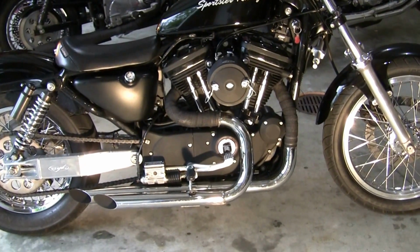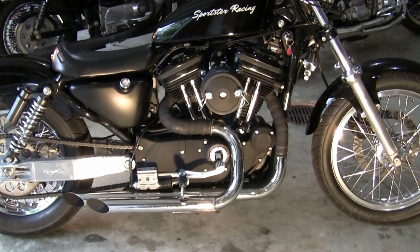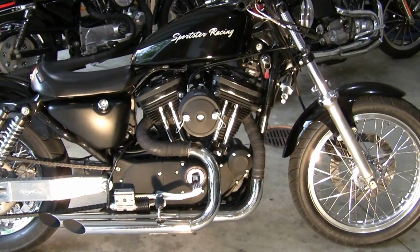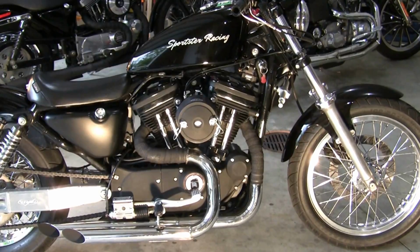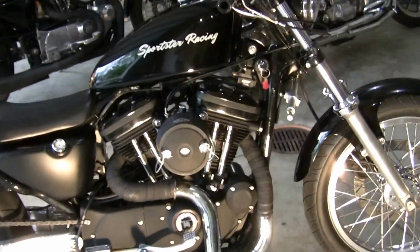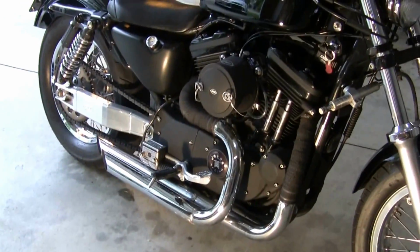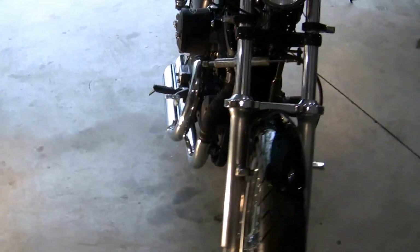Dan reworked the heads with the squish band, so it's almost a bathtub design inside. The Buell Thunderbolt head's really nice. Jacked it up to about 12-to-1 compression. Small problem: for 94 street octane gas, I get a little ping, so I've got race gas in it, and I use octane booster additives. We'll see how that goes.